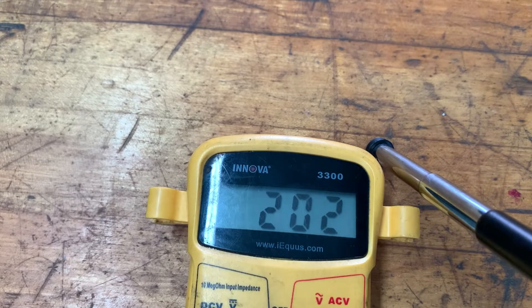So now I'll turn it around the other way. I'm going to put the positive onto the stud on the back and the negative on the casing. I'm getting a reading of about 10, which is backwards from what we want. We don't want to see current flowing from that positive through the alternator up into the casing and giving us a current. We don't want that.